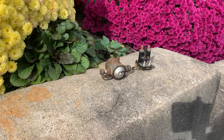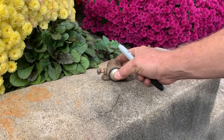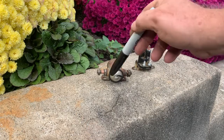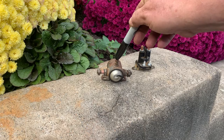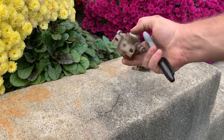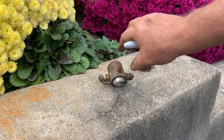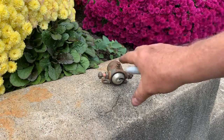The one on the left is from an old International Harvester Cub Cadet, probably from the 60s. It's called a three-post. It has a post on the left and right which connects your battery voltage, and then a switching post which you supply positive to, and it makes this connect with that. The ground is the frame of the solenoid, so as long as you screw it into your chassis and it's connected somehow to ground, this will work.